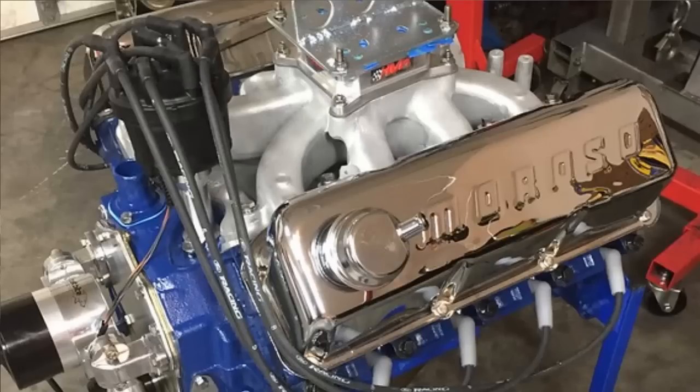But 615 horsepower at 8,000 RPM. I think towards the end, after we tried to do an apples to apples comparison, the same carburetor and the way everything was set up between the two cams, I pulled the air hood down over the carburetor so that the carb could get a nice dose of cold, fresh air, and we picked up another 5. So I think we ended up with about 620 horsepower towards the end.